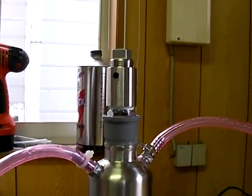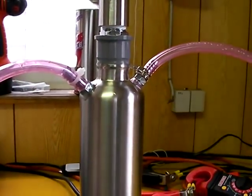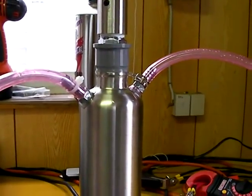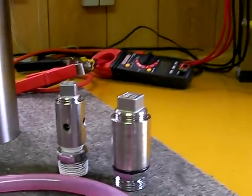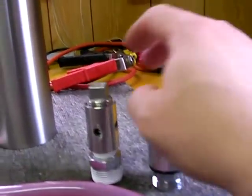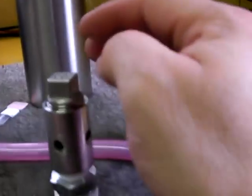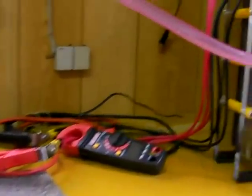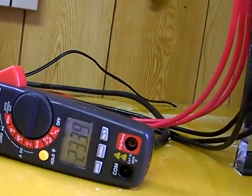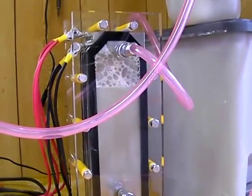Right now I've got the three-quarter inch flash bubbler installed. I need to drill one more hole in that, and it's going to hit a heavier spring to hold the pressure in there. I don't know what PSI I'm pushing right now, but I've got a little back pressure built up. Here are the additional flashback pressure dissipators — this is the quarter inch flash dissipator from my first YouTube video. My cell is drawing 23 amps — that's my nice cell doing its job.